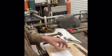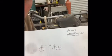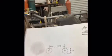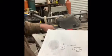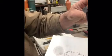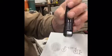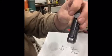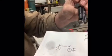Quick measurements are spacing, bore center to bore center on an International block that's been sleeved with a bronze bushing is going to be 2.158 center to center. Stock GM lifter outside dimension is going to be 0.843. You can borrow a reamer, use a reamer, whatever you need to ream those bronze bushings. Most engine builders have reamers for small block Chevy, very popular stuff.